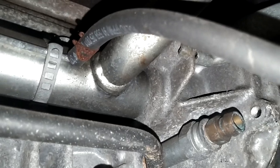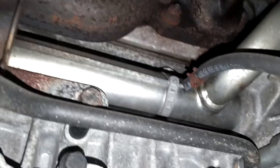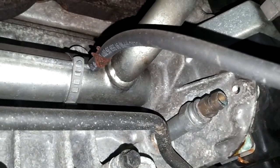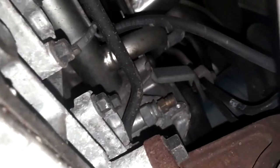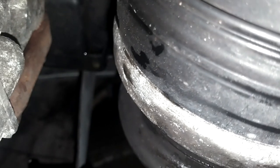So we want to try the water pump gasket itself first since that would be the easiest. I don't see any leak, no evidence of a leak, no old water residue. Did it leak worse when the car was running? — It would leak when it was sitting, definitely at idle. It leaked out a little because he filled it to get here. We don't see any evidence of a pipe leak there. However, at the corner of the timing belt cover, I see water there — is that the water pump? I didn't spill any on the timing belt cover, so there shouldn't be any water there, and there is. So we're going to go ahead and pull the water pump, clean that off, reinstall it, and see if that fixes the leak.